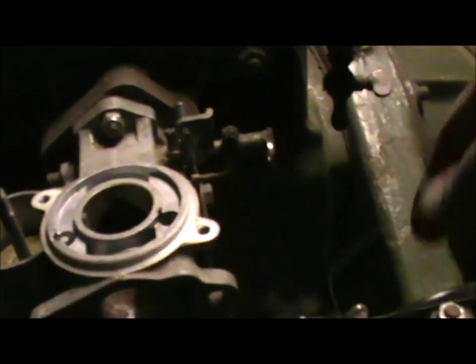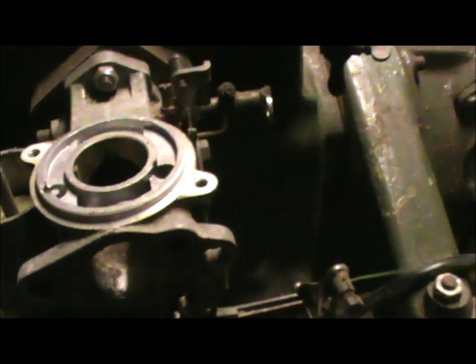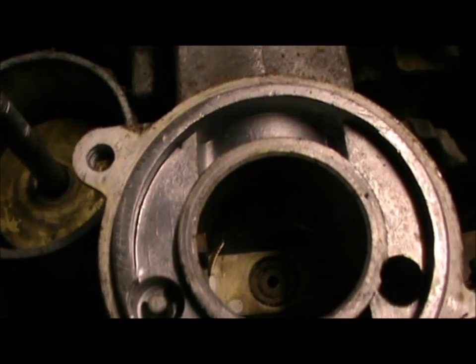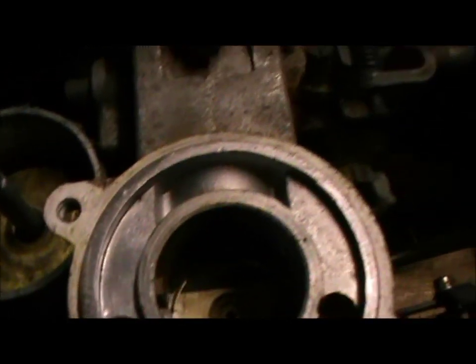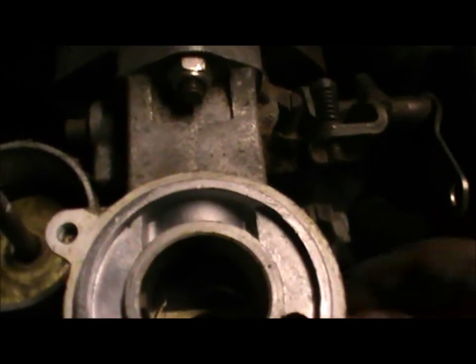This one with this bit of fishing line — it's not a choke, although in a car it would have a label saying choke. What it actually does is when it's lifted, it pulls the centre of that jet down, making the hole bigger and richening the mixture for cold starting. It's not technically a choke — a choke would be a valve that restricts the amount of air going in. This pulls a jet down to increase the amount of fuel mixing.